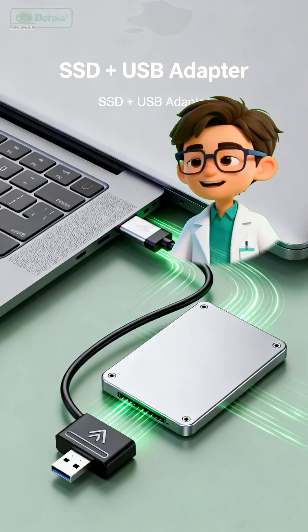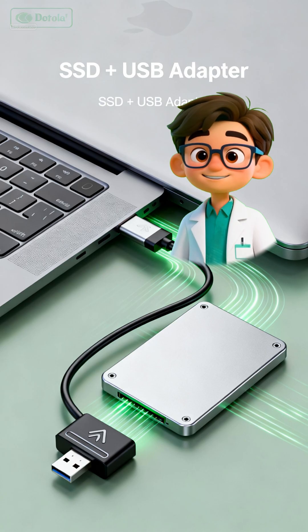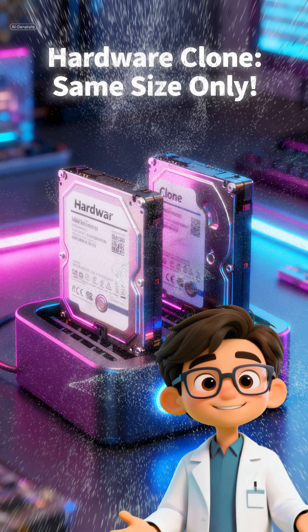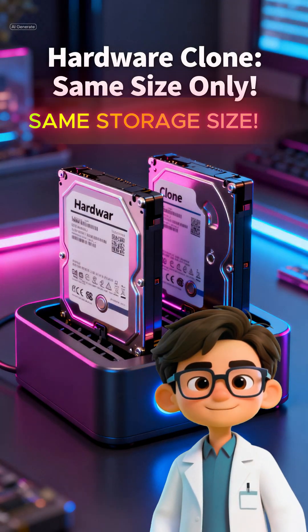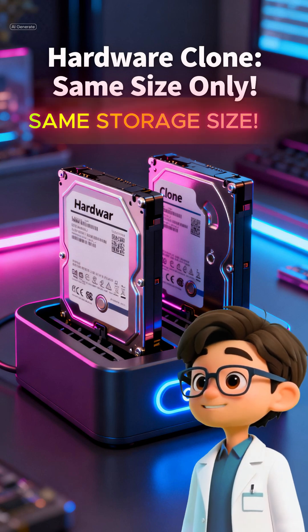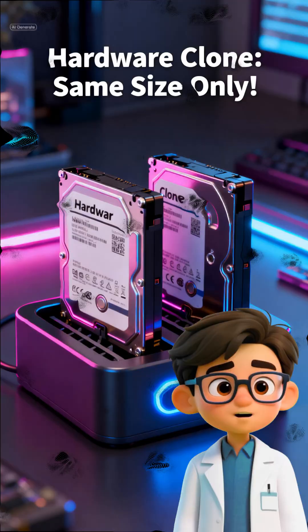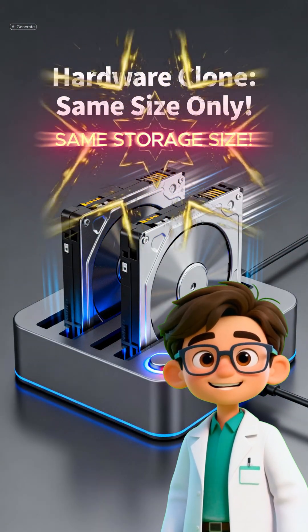So, how do you do it? First, you need a new drive — the SSD — and a way to connect it. That means either a USB adapter plugged into your computer, or you can use a hardware cloning dock. These docks are simple: put the source drive in one slot, the target drive in the other, hit a button, and the cloning starts without even needing a computer. But beware — these docks usually only work if the drives are the exact same size.